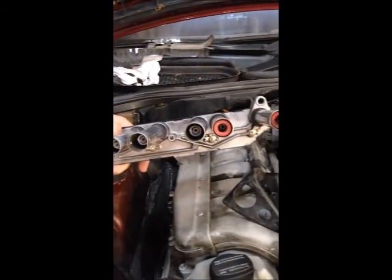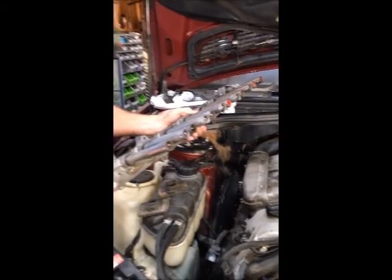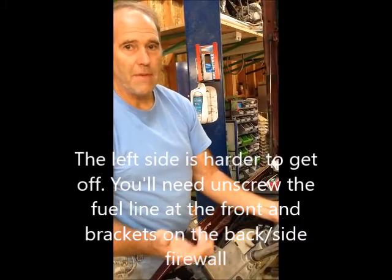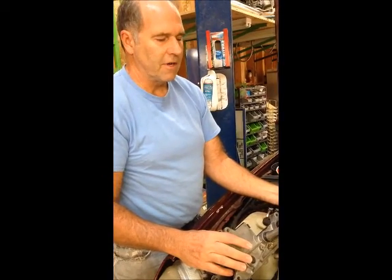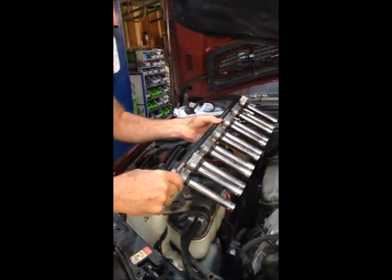So anyway, this is the coil pack, and this is what Mercedes wants $1,200 to replace if you're showing a cylinder misfire. Don't necessarily assume it is the coil. It could be a bad spark plug if it's been a long time since they've been in there, 100,000 miles plus. So make sure that your plugs are good. I realize it's a bit of a hassle to take these things in and out.